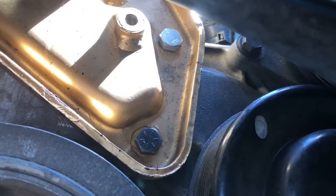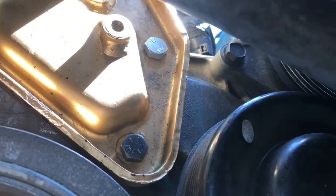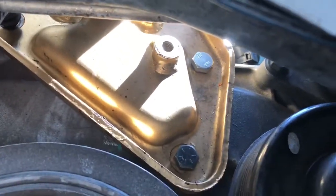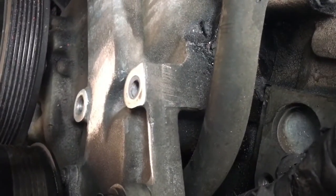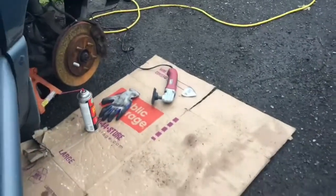Screwed these all the way down, making sure I tested the depth of my tap. The longest bolts I could use here. I'm going to pull them back out, remove the bracket, and JB Weld the heck out of it. These are prepped holes — got them sanded way down. Even used Q-tips to get the dust and stuff out. Used 60-grade sandpaper to sand it all down.